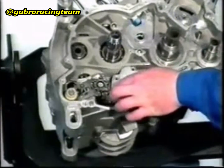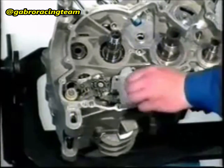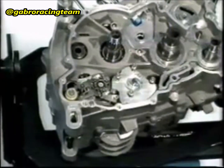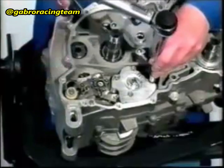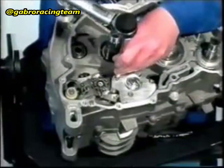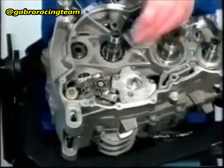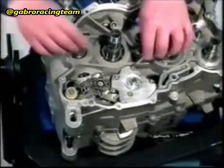Insert the lubricated external rotor in the oil pump casing. Fit the oil pump cover and fasten it with 4 M6 tube-headed screws. The tightening torque is 11 Nm. Cross-tighten the screws.